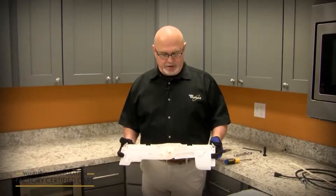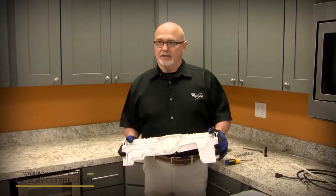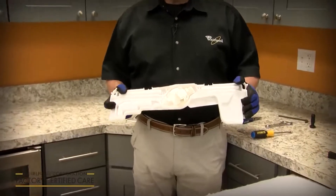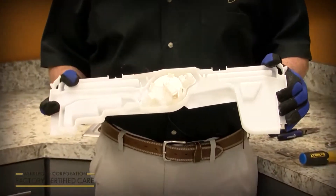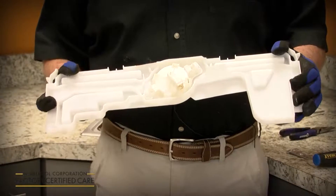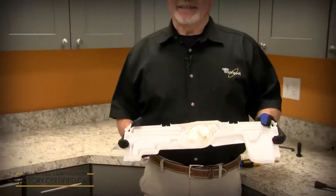One thing I just want to recap: this unit has a new drip pan and float assembly. That's one of the last things you're going to install before you put the front toe panel on. We want you to run a short installation service cycle, or you could do a rinse only — just to get water in it, make sure the unit's working, and check for leaks before you put the toe and insulation panel on. That install service cycle is a real quick key dance: 1, 2, 3, 1, 2, 3, 1, 2, 3.